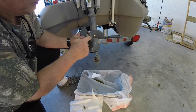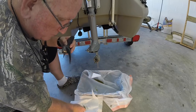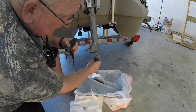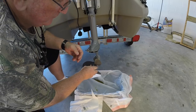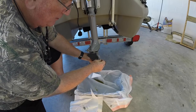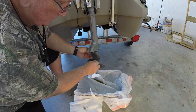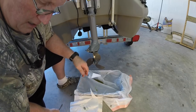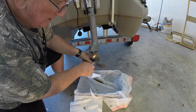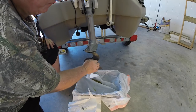Take the propeller, turn it around, make sure there's nothing in there, and put it back on. I want to put the two holes where the pin came through to be horizontal so the pin doesn't fall out, and it stays in place. I can feel it lock in. Thread the cotter pin all the way out the other side, then take your pliers, grab one side and tip it over, then grab the other side and tip it over. It's on there and it can't come off.